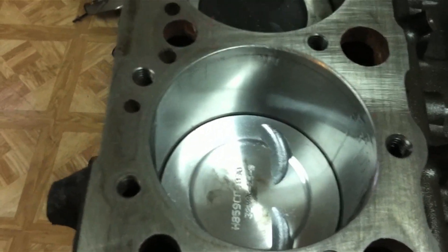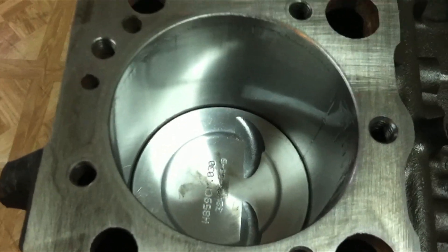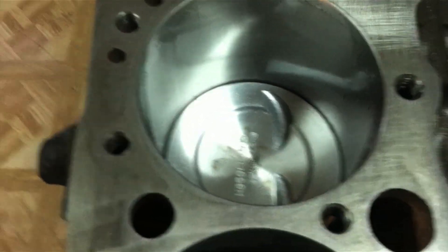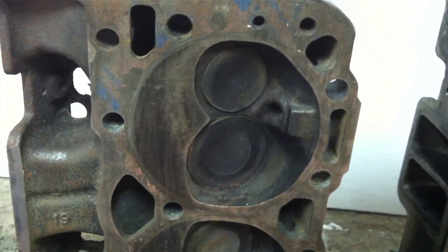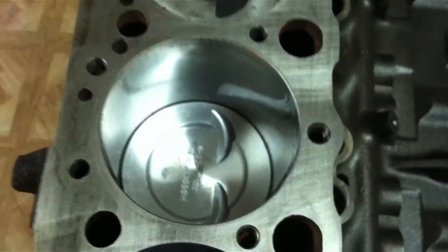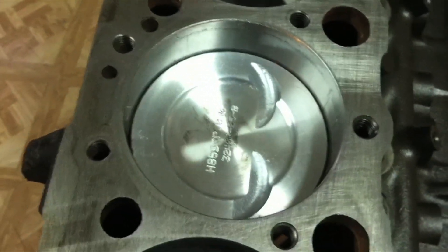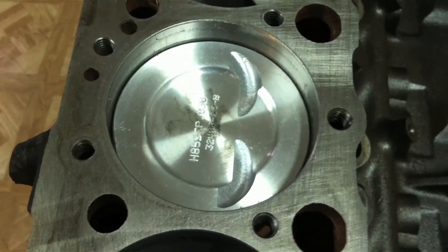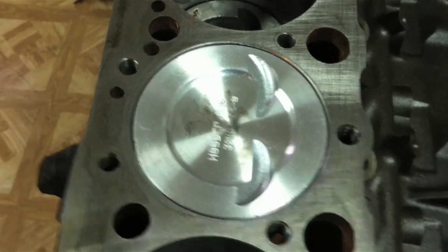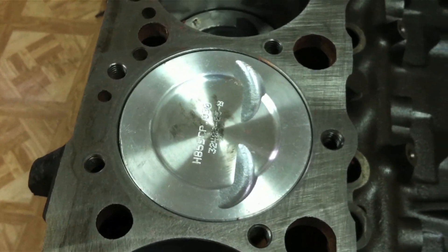So your intake, compression, and power stroke. The power stroke pushes the piston down as the air and fuel mixture burns and expands. On the exhaust stroke of a 4-stroke motor, the smaller exhaust valve will open up and the piston will travel up the cylinder, pushing out all the burned air and fuel, blowing the exhaust out the exhaust valve and out the manifold. That is stroke number 4 on a 4-stroke internal combustion engine.